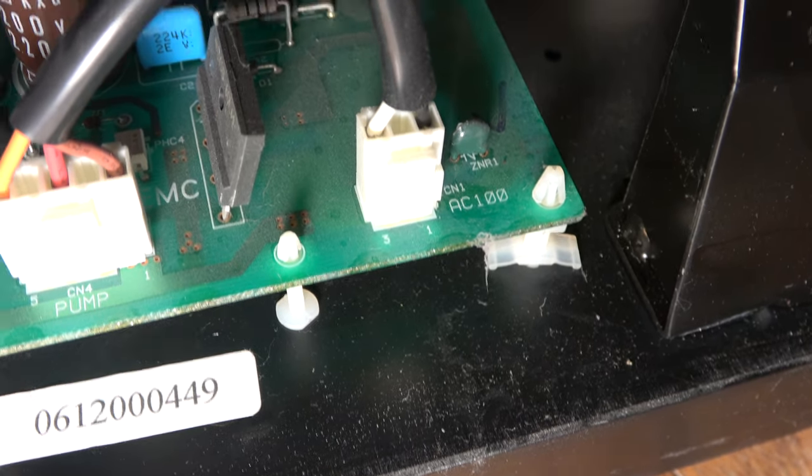Well, what's sub? We don't know where that goes, but if we only have 4 connectors going through to the remote control end, then we know we're not getting powered. So that helps quite a lot. Let's have a look at the remote control end. So here it is. If I just take the back off, see if we have the same four colours as we have here, and if so, this is not being powered. Undone the five screws.